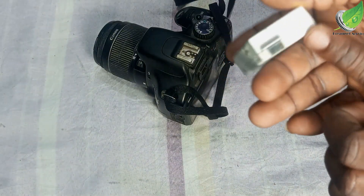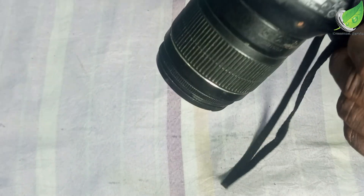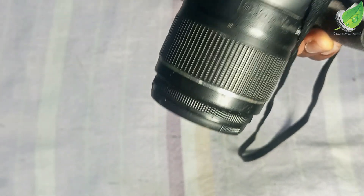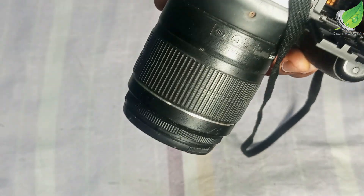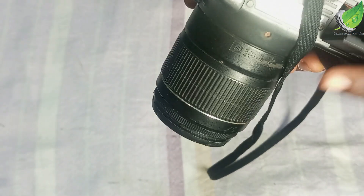Let's remove our battery. This battery is in good condition, but the problem is that the contact on this battery is not connecting to the contacts on the battery terminals of the camera. You can see we have one to three terminals on the camera, and the contact here is not touching those terminals on the battery.